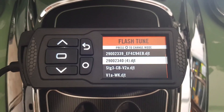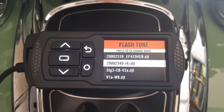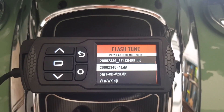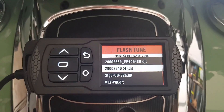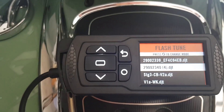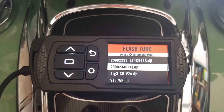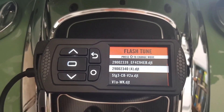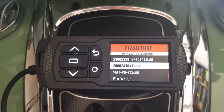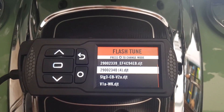Some people think it's a piggyback system, and it's not. It's actually a small remote device, much like dyno tune software, that flashes a new tune. You can use it to monitor stuff as you go, but you can't change things while riding. The Power Commander Five was a piggyback system — that connected to the fuel system. This actually deals with changing the ECU. I've got four flash tunes at the moment that I'm trying out to pick which one's the best.